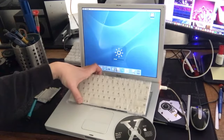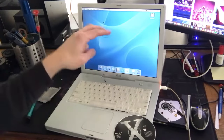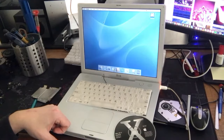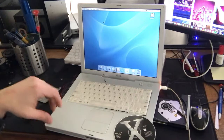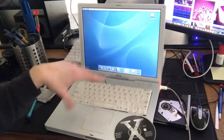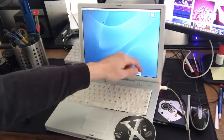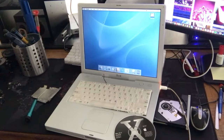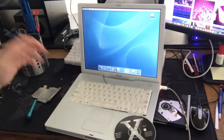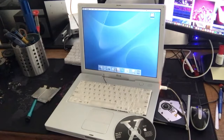One thing too that's cool about iBooks is that the power button has its own distinct connection to the board. Just a simple two-wire connection to the board. So it's pretty foolproof, and you just never had power button issues. Now, that is different than MacBooks. On MacBooks, the power button is part of the keyboard, and then the keyboard connects to the board. So the problem with that is you fry your keyboard, you liquid damage your keyboard, and then the power button's not going to work. So you have hundreds of thousands of people who have a good board, but their machine is not powering on, and so they assume the whole machine is dead. Of course, Apple tells you you need a logic board at that point, even if it's just a fried keyboard, and so that's an issue.